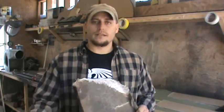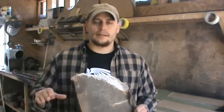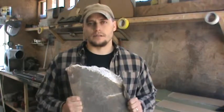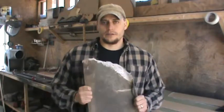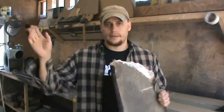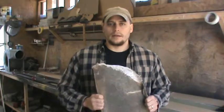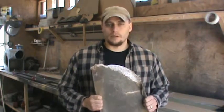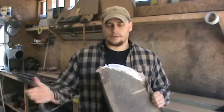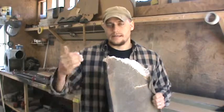The best way is you roll the part out. You take a roller and roll the glass and pack it down real hard, then take a brush and extract all that excess resin out. But this is where you get into real time-consuming work, and this is what a lot of people won't do — it's more important to just put it in the mold, lay it up, pop it out, and go to the next part. As most of you know, I'm very picky and I want things done a certain way. I roll them and pack them hard and extract all the excess resin. It's just as important to me how the back side of the part looks as the front side.